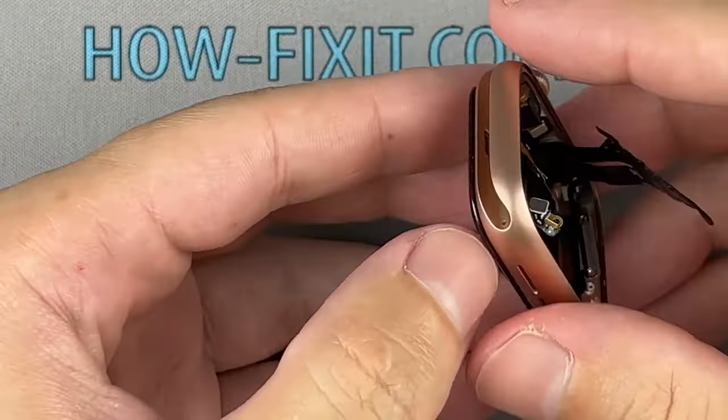Disconnect the mainboard ribbon cable from the back glass. The back glass cover includes motion and heart rate sensors, and a wireless charger coil. If the motion and heart rate sensors fail and are not working, replacing the glass cover assembly will fix them. In the description, I left a link to the back glass cover for Apple Watch.